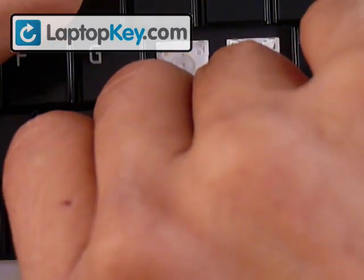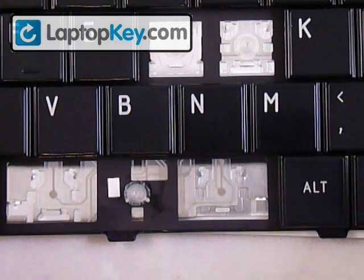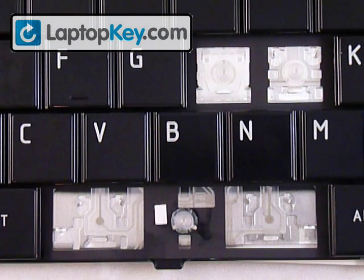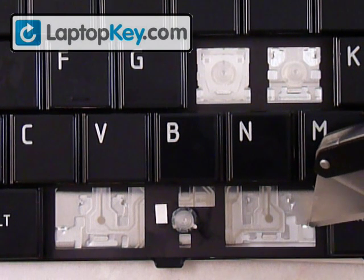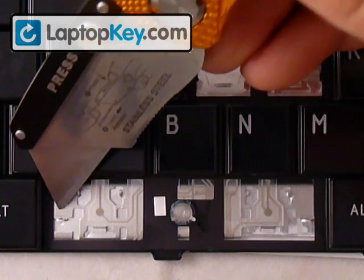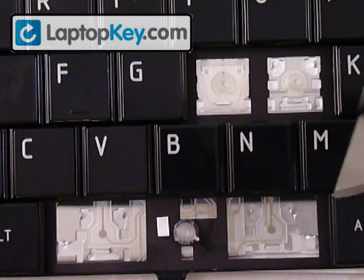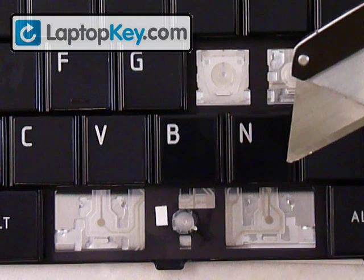So you just put that right in the center and allow it to dry. Now, as far as the hinges, you can see that at the very right of the spacebar position there's a metal plate — it's more like a hole — and you have the same plate to the very left. Those are going to grab onto a metal wire that goes on the key itself. The metal plates we're going to use right now are these two that look like hooks.